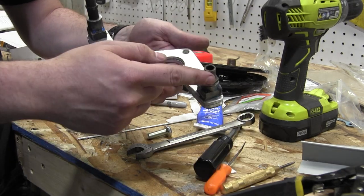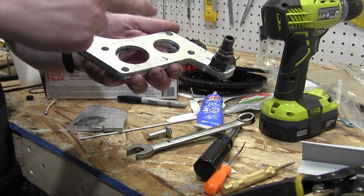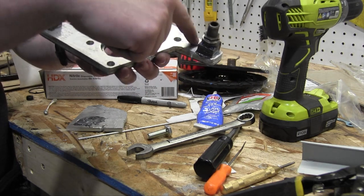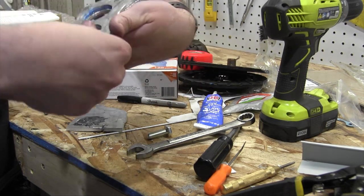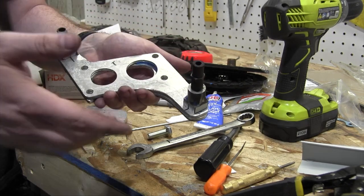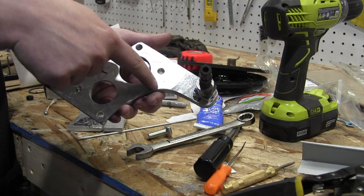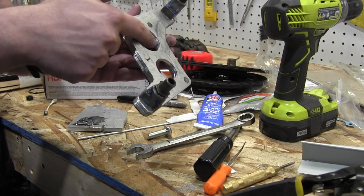This line goes to the brake booster. The vacuum channel feed is in here that you probably can't see. I just milled a groove by abusing a drill press, so there's a channel for vacuum under here going up to this line and over here. It's the same thing, except this is the PCV valve, and this goes to the valve cover, not the intake manifold. There's a groove running straight through here. You might even be able to see it on camera, or the opening for the groove anyway.